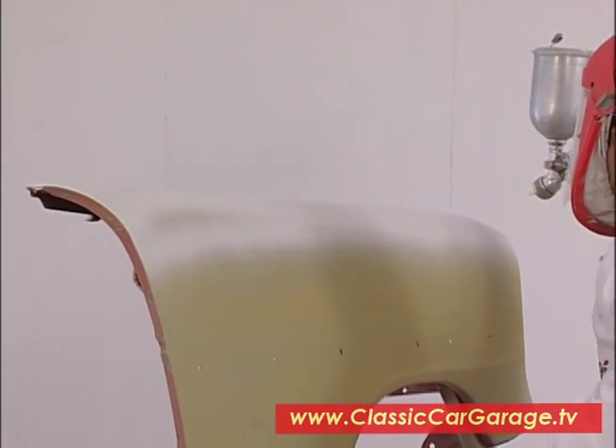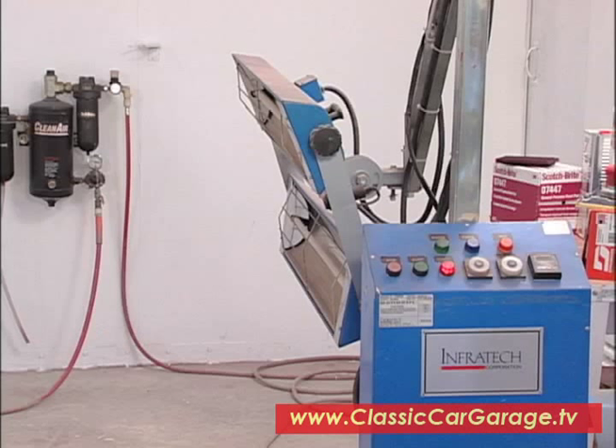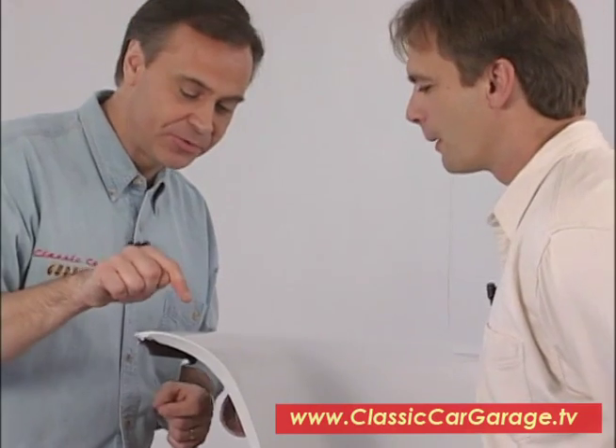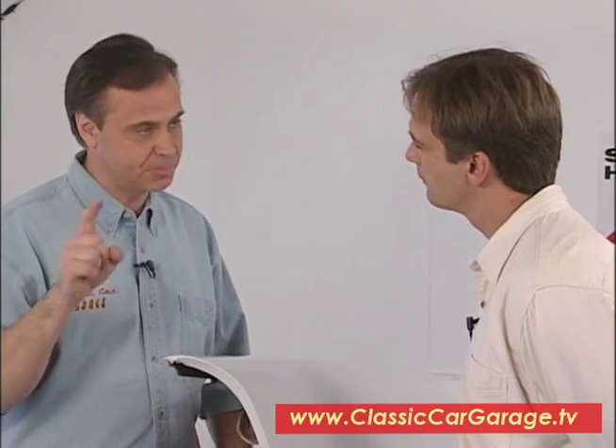We're going to use an infrared heater on here, bake it for approximately a half an hour, and then block this down using our straight-line sander, and do our plastic work over the top of this so we've got a really nice bond onto that bare metal. We're going to bake this for an hour with the InfraTech heater at around 100 degrees. If you didn't have an InfraTech heater, you would want this to cure for about a 24-hour period. The next step is going to be spraying a guide coat and block sanding before doing any body work on the panel.